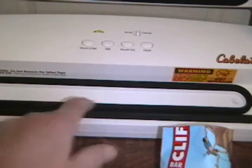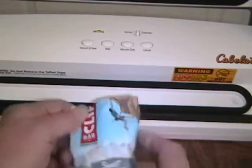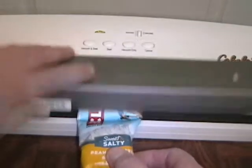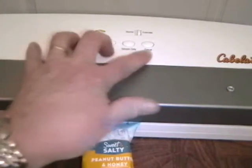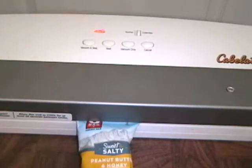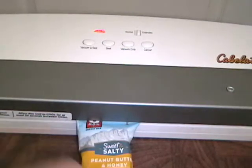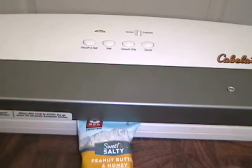There's a gasket — that's a pressure gasket — and then this is the line to put sealable material over. It's locked down. All we want to do is seal. We have vacuum and seal, seal, vacuum only, and cancel. Extended means it takes an extra longer time to seal the product — we're just going to seal it. That's applying heat across a wire to the material of the bag. That last sound was verifying that it was sealed; if it were not, you would have seen air being sucked out of that bag, but there was none, so that indicates it's good to go.